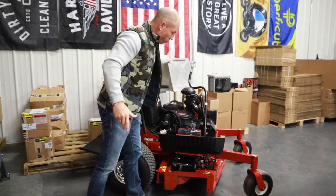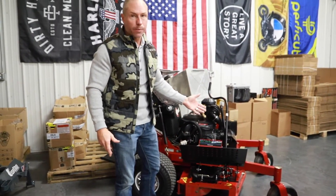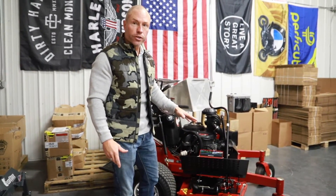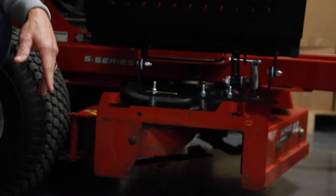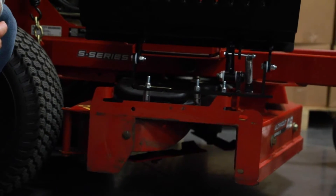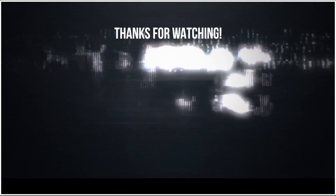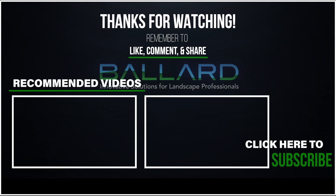Right there, looks like we've got full movement all the way open. This stays open when you're mowing — you're going to be mowing with this open 90% of the time like normal. You close it down in those tight areas. Again, this is the Exmark installation. Most mowers are similar — just remember you've got to use the spacers to raise the mounting bracket up above your factory grass tabs like here on this mower. We're going to show you on a couple other models. We appreciate the support — check us out at Ballard Products website, and on Facebook, Instagram, and our YouTube channel. Thanks guys, we'll see you next time.